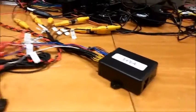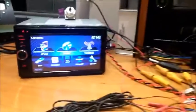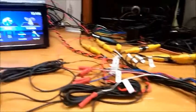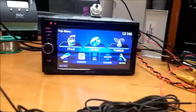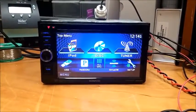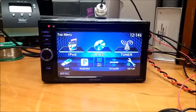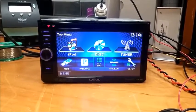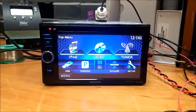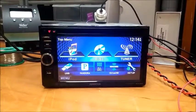I've wired this kit up on the bench with an aftermarket Kenwood screen. This kit can be connected to either aftermarket or factory LCD screen. It's got to be a full color screen, and it's got to have a composite reverse camera input. It also has to be triggered by a wire or forced action — it has to be over wire. If you're using a NAV TV OEM integration kit, it has to be triggered over wire. You can't use the factory force dash buttons.